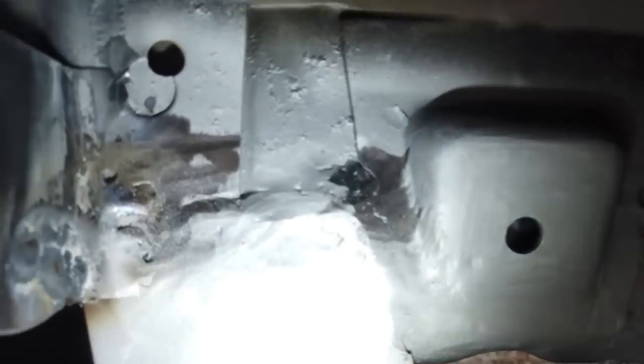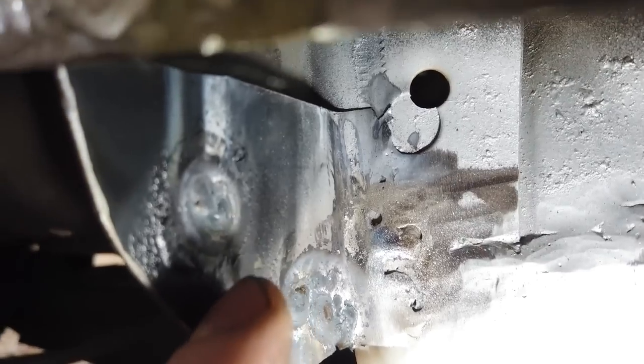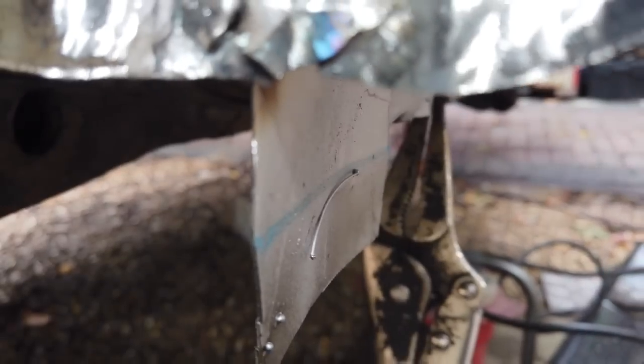Usually what you find is this plate's gone at the end, which is that plate you can see there. It is part of the wheel tub, or would have been part of the tub, and the tub comes down. It's in two halves, the tub, but they're usually supplied welded together. Sometimes you've seen them in just a half piece. But that goes all the way down. Where that circle is now, that inspection bung for the sill, it's actually blocked up now because that plate blocks it up. You re-drill it after. It would carry on going down like that, in that shape.